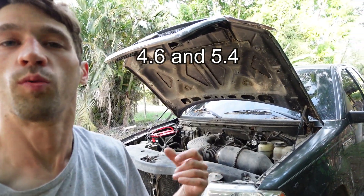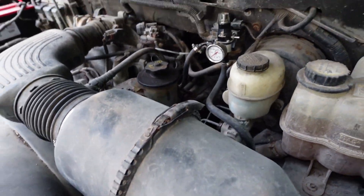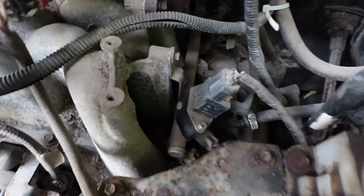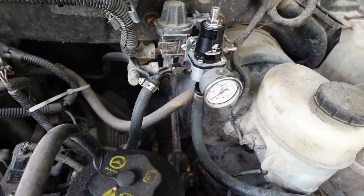This is for people who want to modify the 4.6 liter motor for a return fuel line to the tank and a pressure regulator, so that when you turn the pump on it runs constantly and the rail gets a steady 40 psi. The only important parts of this system are this nitrous block and this fuel pressure regulator.